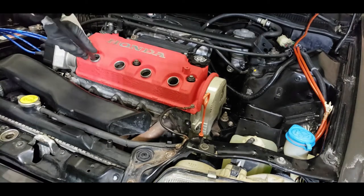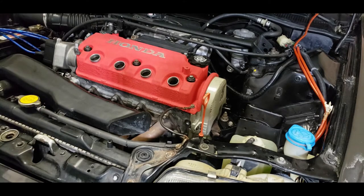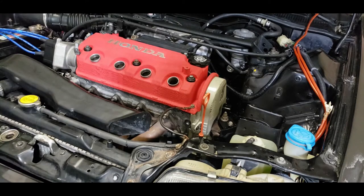So, I mean, it's possible that it is a rod knock, but I guess I want to check everything before I make that decision. I don't really want to pull off the oil pan gasket. All right, so now I guess I'm going to do a leak down test. I could just run a wet test to determine if compression goes up or not if I put oil into the spark plug holes, but I'm not going to do that. It looks like it's pretty good compression